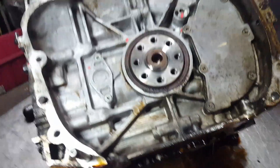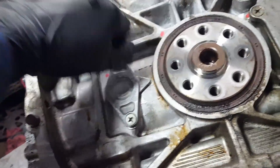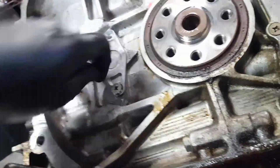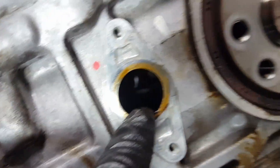You're going to have to remove the piston pin. I've already removed the other one in here. We're going to remove the cover and the pin is going to be there, so we're going to have to spin the crankshaft so we can move the cylinders and then the pin is going to go through there.